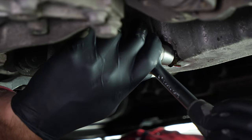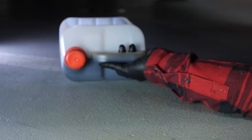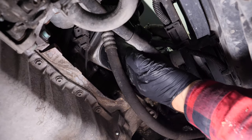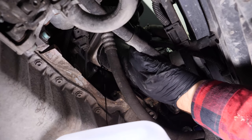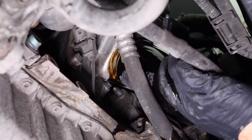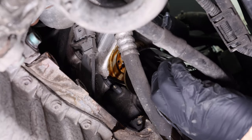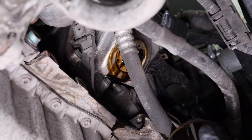When performing an oil change, it is necessary to replace the oil filter. Access to the oil filter is done from underneath the engine compartment. To avoid letting the oil inside the filter flow out, place a collector for liquids under it. Loosen the oil filter. If you're unable to do this by hand, you can release it with an oil filter wrench. If the filter remains stuck, watch our video on unscrewing a blocked oil filter. Remove the oil filter. When released, turn it upwards to avoid spilling any oil.